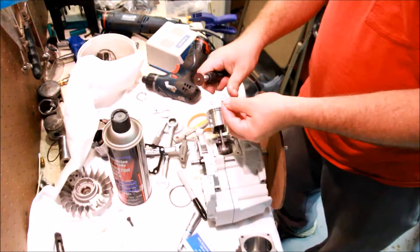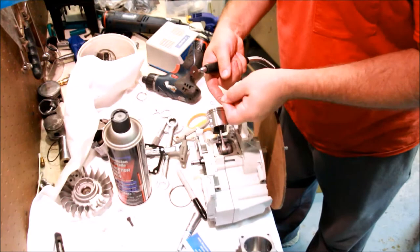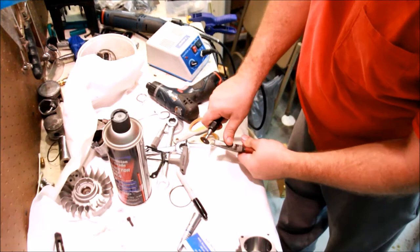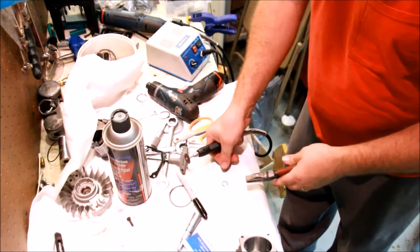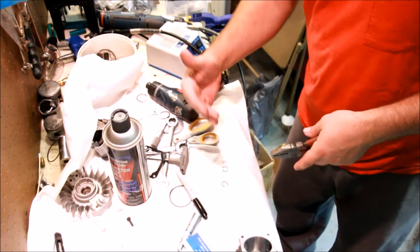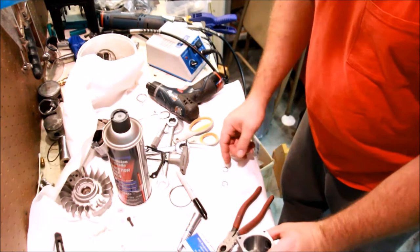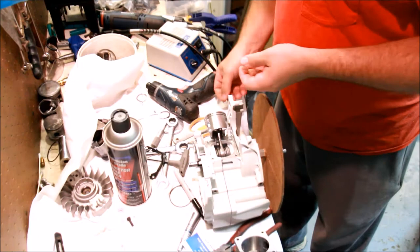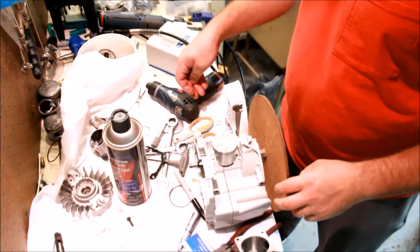Hot tip: don't grind the ear off over your crankcase. In addition to the shavings, if the piece gets lost it might be in there and then you're sunk. So don't do that. The reason for this is that that ear has a significant amount of momentum at 13,000 RPM. It is entirely possible — however unlikely — that it can compress or elongate enough suddenly to pop out. Everybody's heard that these have had trouble with that, so that's why we do this.